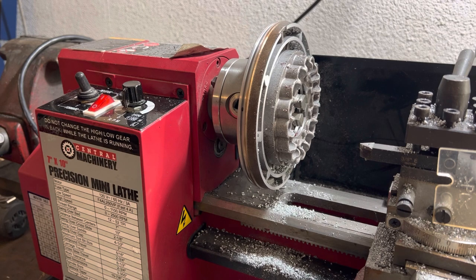This time going with six direct clutches, six forward, and four intermediate clutches. Part of this process is making your apply pistons a custom thickness. In my application I have a 1969 Turbo 400 and a 1970 Turbo 400. Both transmissions came with apply pistons that were either 700 thousandths or 750 thousandths thick. If you watch builders like Sean Mountain on Mountain's Garage, he talks about cutting the apply pistons down to 600 thousandths — that's going to be an arbitrary figure for specific drums and specific clutch stacks to fit six clutches.